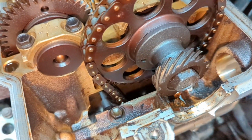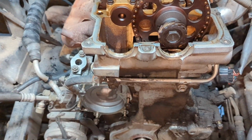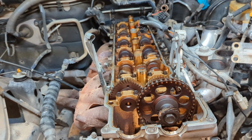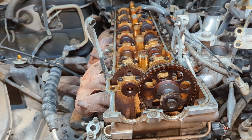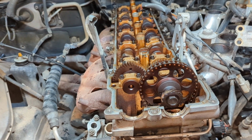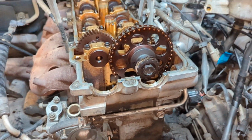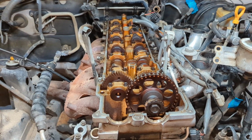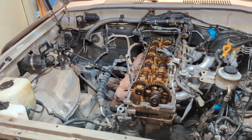You know, everything looks good there as well on the timing chain. Maybe give me an opinion down below again. I know I asked for y'all's opinion last video. Now seeing some of this stuff under the valve cover, what do y'all think? Should I pop this head off and replace the head gasket as well? If I do that, then it would be a good opportunity to re-ring the pistons and put new bearings in the rods. But then I'm gonna have to get machine shop involved for the head. My feel at this point is that it's probably unnecessary, and I think I'm gonna leave the head gasket alone. Yeah, okay, that's that. Head gasket is being left alone, I think,